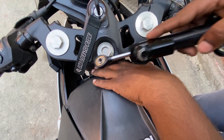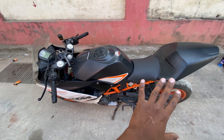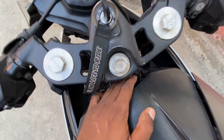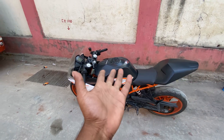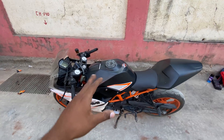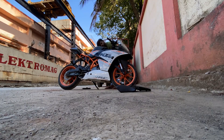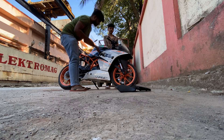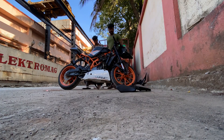The main challenge we are facing here is that we have no existing mount. We need to fabricate a mount for the forks and for the steering stabilizer — we need to weld the mount onto the chassis. The RC fairings need to be removed first. I will give you the link to the previous video where I explained how to open the fairings completely.